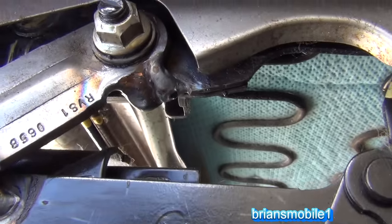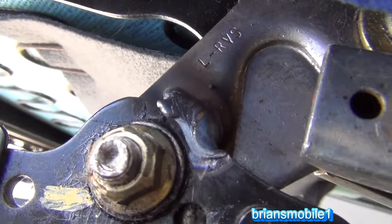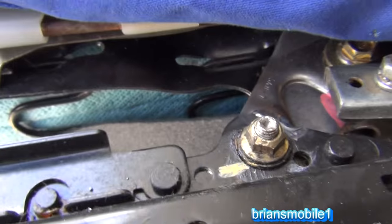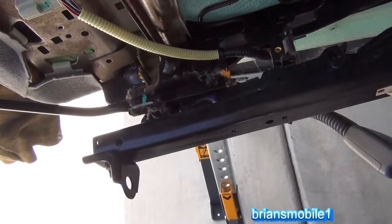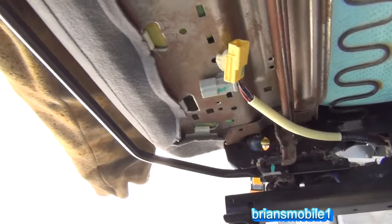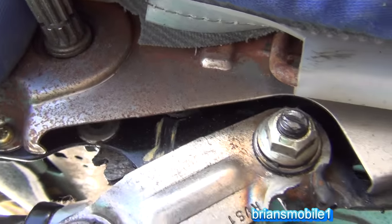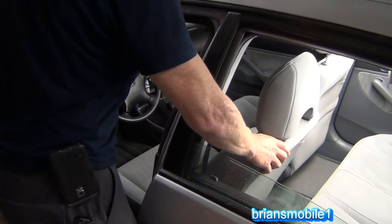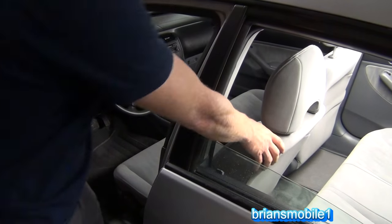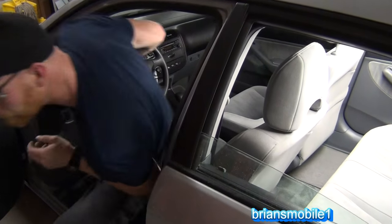This is how the other side turned out — it turned into more of just a tack. I got too hot and stayed on it too long on this one; you can see where it started to slump. And then this one turned out really pretty. I didn't light anything on fire, and I don't see any burn marks. I want to check the wiring and everything for all the airbag-type stuff — this is a pre-tensioner — I just got to make sure I didn't damage anything with the seat belt, the pre-tensioner, or any of the electronics associated with it. A lot of this doesn't get any paint because it's indoors — you can see it gets light rusting. So we're back to where we started, except now I can shake the whole car by the seat and the seat hardly moves at all. It used to just rock like crazy, but now the car rocks and the seat doesn't. That's what we like.